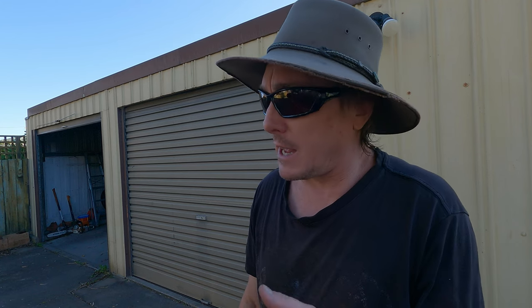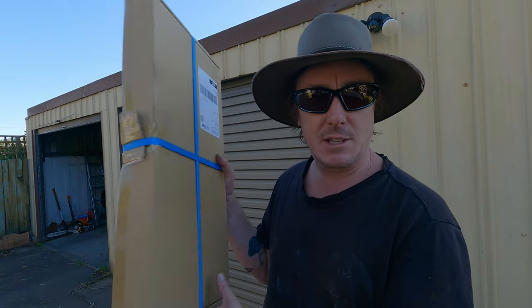The job's done. I'd rather do it in the driveway here than in the middle of the remote high country. These are the types of little checks we've got to do when we take our vehicle out bush — going through rivers and all that sort of stuff. These things do wear out and they're hidden little pains, especially that hose down there. If you're in the middle of the mud somewhere in the wet and it lets go, your car starts to overheat, then you've got to troubleshoot why and where — and if it's already wet, how are you going to find the leak?